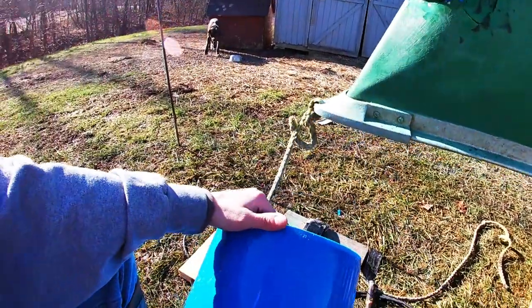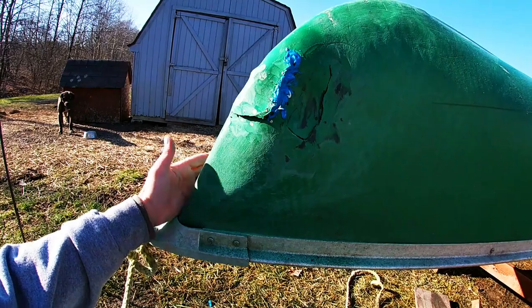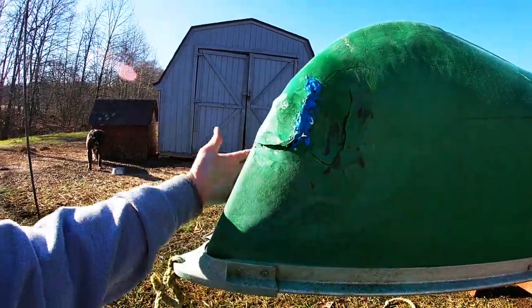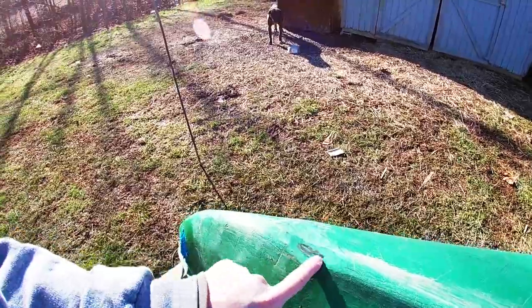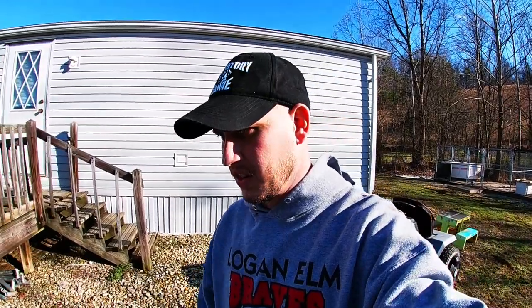Sand that down, and I'm going to cut this bucket in half. My plan is to wrap the nose — I want to wrap this nose, definitely come back in here past these cracks and cover this whole front end. I just want to let you guys know that the HDPE bucket works a lot better than that mud flap. I recommend if you're going to patch your boat to get the proper stuff. The bucket is actually a little thinner so it melts quicker, and it melts at about the same time as the boat, so they melt together real nicely.